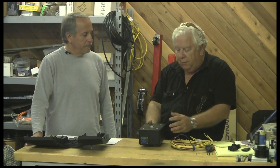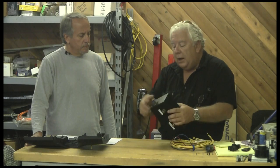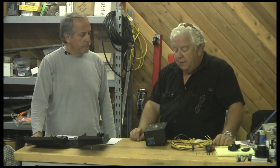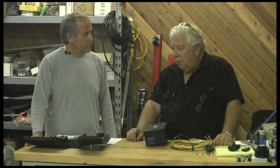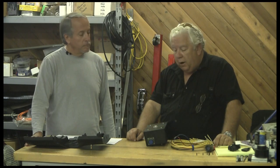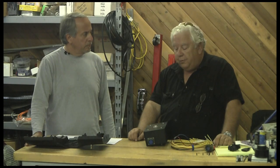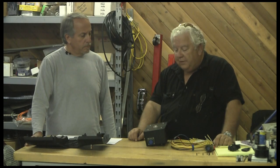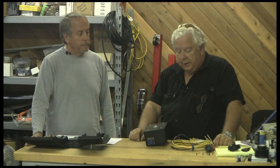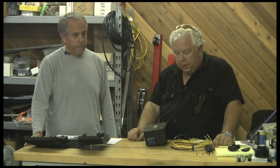It just so happened this sits down in there and we don't even have to mount it — it sits down on the plate that holds the batteries in place and is very firm without even mounting it. So I can pull it in and out, plug and unplug it. We're going to put this in that space along with a couple of other Amphenol connectors for battery wiring, a couple of RS-232 ports for BRUSA chargers — so that space is filled up with instrumentation. We'll lay the BRUSA in there flat and I think it'll be great.